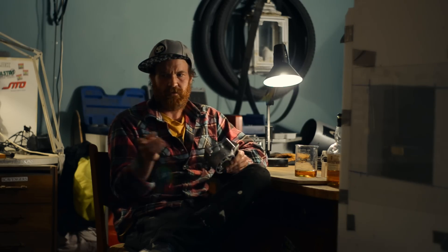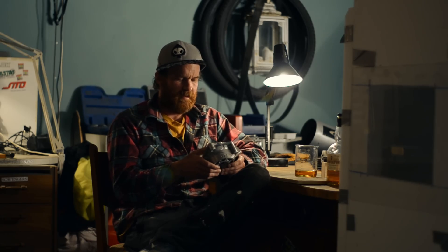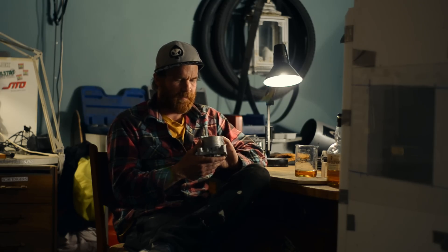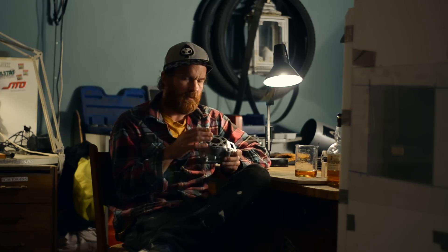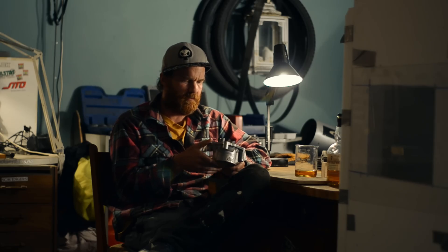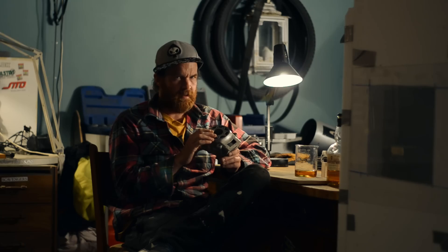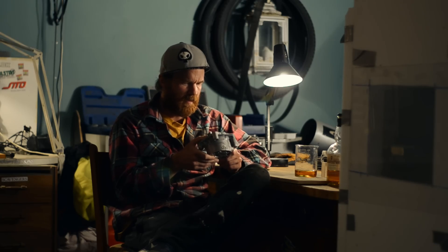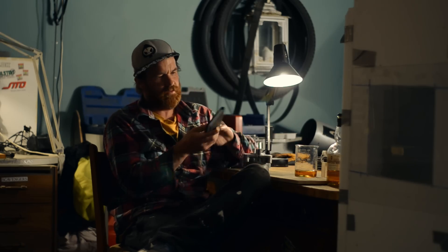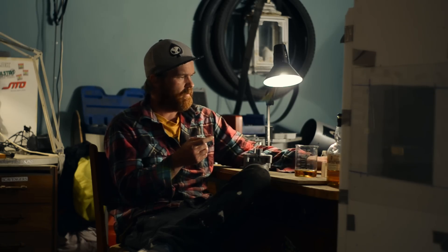I thought I was going to get stuck on the plating and basically struggle for a good while. But I haven't. It's been pointed out that my coating is honing much faster than what Nikasil cylinders do, and maybe the coating is too soft. I received a set of hardness testing files today, so we'll check it.